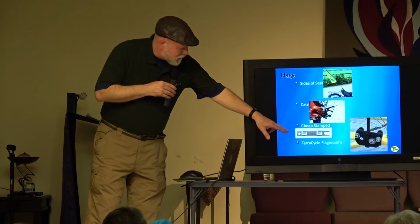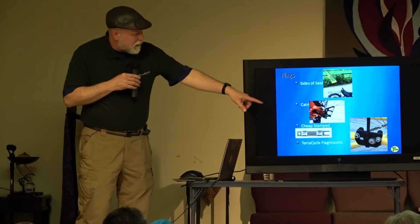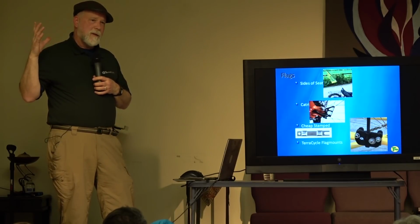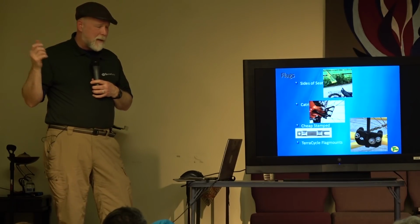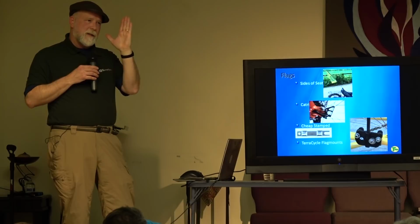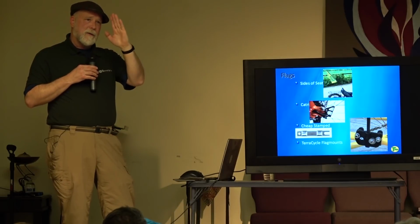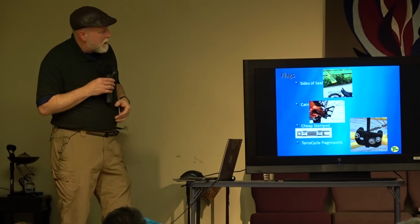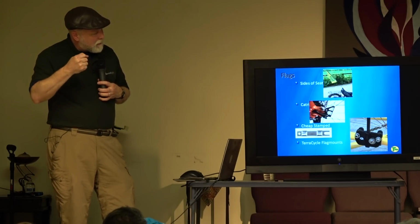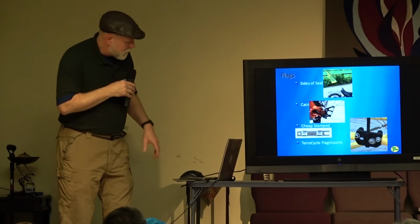The other standard mount out there is cheap stamped steel ones for kids' bikes. I'd recommend avoiding those. We make a new little mount that's very, very versatile that again uses cat-eye clamps so that you can clamp it to almost any size of tube that you happen to have. And it's adjustable angle-wise so that if the tube is anywhere from vertical to horizontal, you can put one of those on it and hold the flag at the angle you'd like. It's got a little rubber washer in there so that when you plug the pole in, it snaps into the rubber, and the rubber grips it.